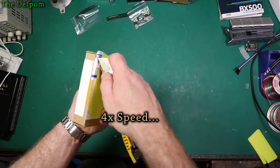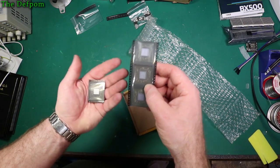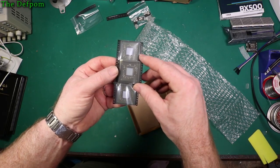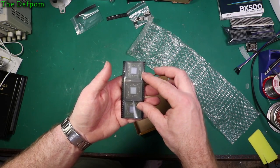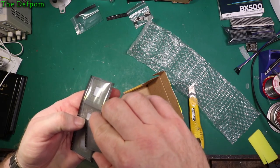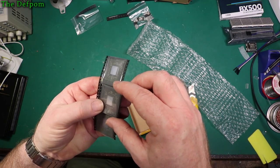These are AMD GPUs — the ones used in the MacBooks. I've got a MacBook which has definitely got a blown GPU; I've already removed it from the board, and these are some brand new ones. I've purchased four of them — they weren't that expensive. It's a known problem in these particular MacBooks that the GPUs fail. The date codes are 11.23, 10.44, 12.32, and 11.03 — all different dates, so they're probably not brand new and are likely repackaged or salvaged parts. But as long as they work, I don't care.